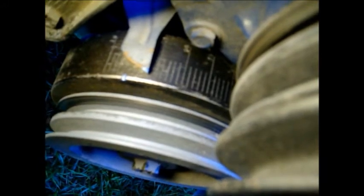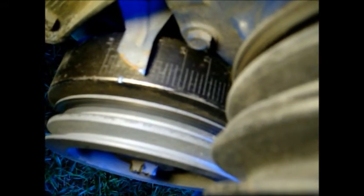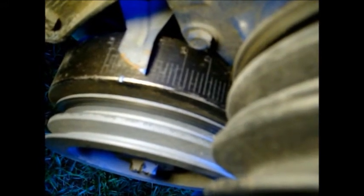And just clean off everything else there so there's no confusion. Obviously you only want two spots that have the blue RTV on there. You want the one spot on the pointer and then the one spot that is actually top dead center of your number one piston.